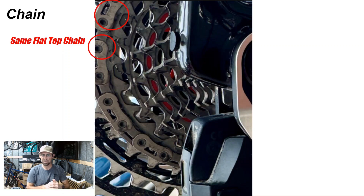You may be asking how they can just add another tooth. Well, if you look at a big cog and think about your spokes — your spokes all go inward — the larger the cog you have, the more you can dish the cog inward toward the spokes. Also, with T-Type mountain bike 12-speed, they were actually able to move the whole cassette and sandwich it outward a few millimeters, so there's room for another cog. The downside is you'll have more cross-chaining when in the largest cog, which causes the chain to bend and allows dirt and debris in, affecting chain wear and increasing drag.